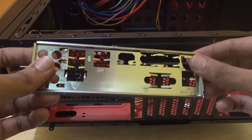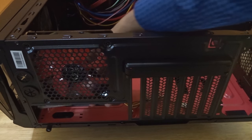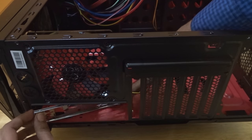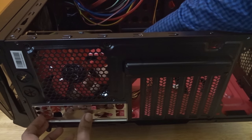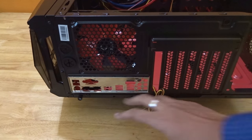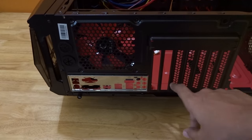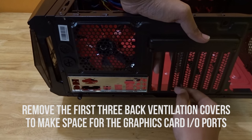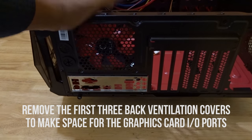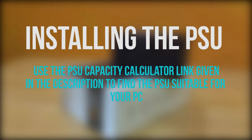The IO shield given along with the motherboard is not just a silver or aluminium plate — it actually acts as an alignment scale for fixing your motherboard inside the CPU cabinet. If all the IO ports in your motherboard come out of this IO shield, then you've fixed your motherboard perfectly. Grab the IO shield and fit it into the ventilation port on the back of your CPU cabinet. After fixing the IO shield, open at least the first three ventilation closures on the back of the CPU cabinet — those are for leaving other IO ports that you'll connect later.